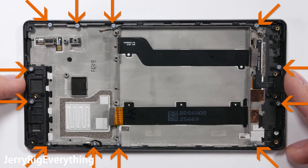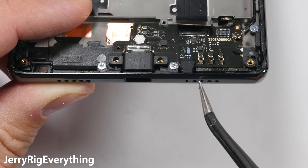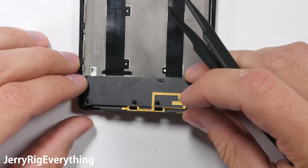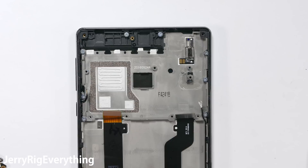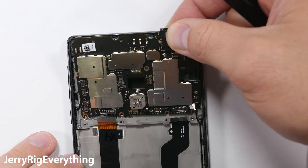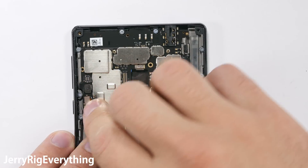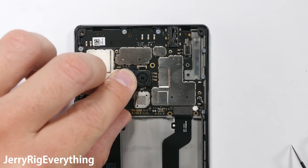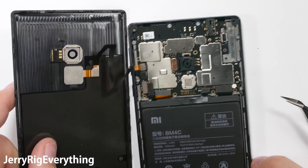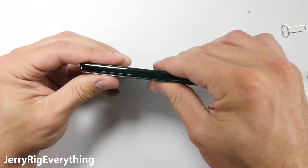I'll get those 12 screws around the ceramic frame in place, and then the charging port can go back in its slot. Down here at the bottom microphone holes, most of them are for decoration — the mic only fills one hole, so make sure that particular hole is never plugged up. Get that wire cable plugged in, along with the two ribbons next to it, and the front facing camera. The plastic loudspeaker and its 5 screws go down on top of that. Then the piezoelectric speaker gets set down before the motherboard does — there is a little pin and a screw hole that guide it in place. The motherboard can be set down after that, clipping in the wire cable, the extension ribbon down to the charging port, the screen ribbon, the power button ribbon, and the front camera ribbon. Then the rear camera can also get snapped in, and finally the battery. Before putting the protective plastic layer in place, make sure that the fingerprint scanner is also clipped in, just like a little Lego. 10 screws later and you can take the ceramic back and snap that into place. Make sure that the phone is working first, because getting the back panel off if you forgot something is a real chore.